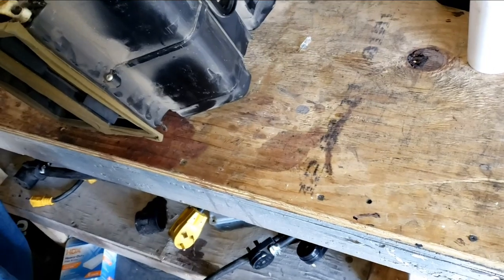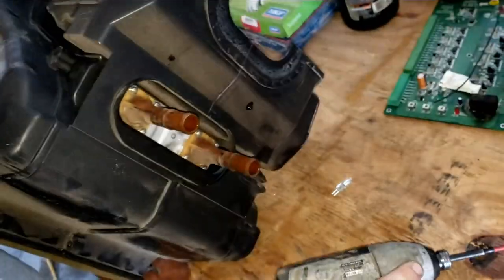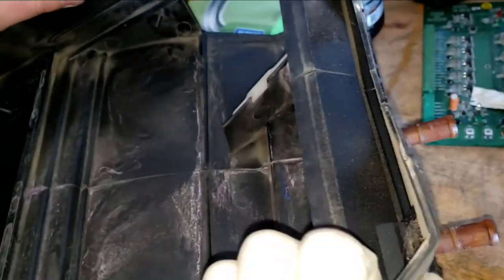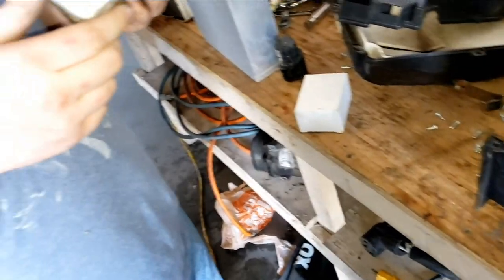I can already hear them — why are you rebuilding your Sentra? Well, I mean, you're not wrong. All right, let's put it on this flat end right here. Can we spread it? Does it spread? Something else has got to be holding it — it's like the final key hidden right in there. That screw, and that screw, and that screw. Then we can separate it — the blend doors stay in because they just have pins on one side. Where's it leaking from? Sure it was leaking — it was coming out of the evaporator. Evaporator complete.